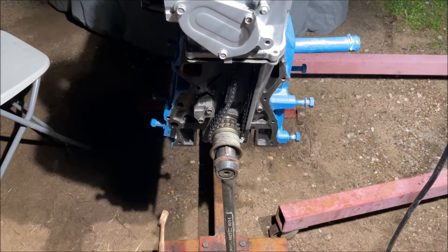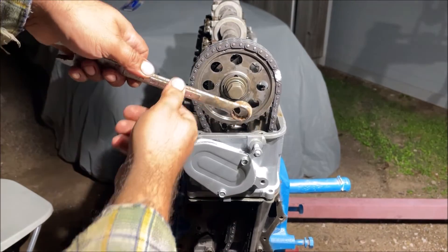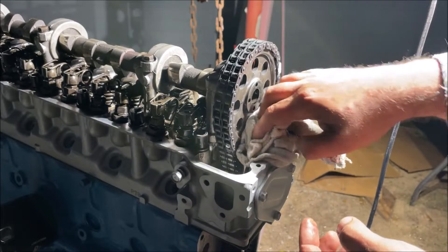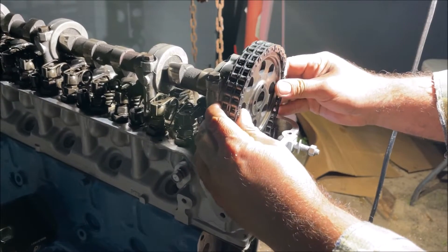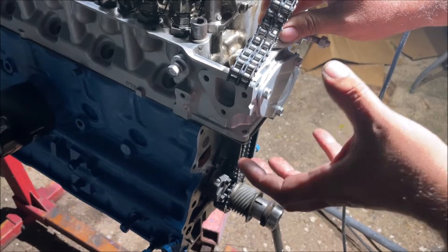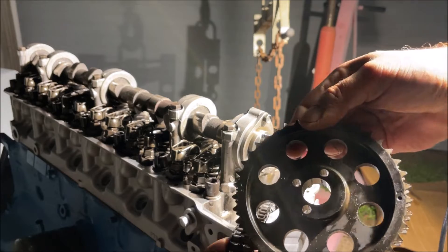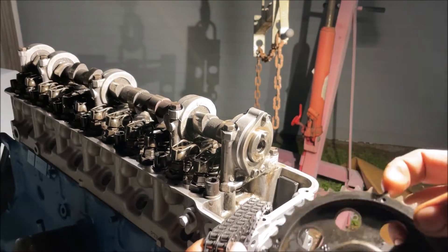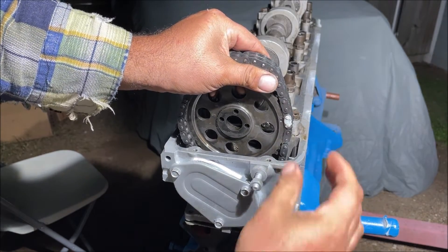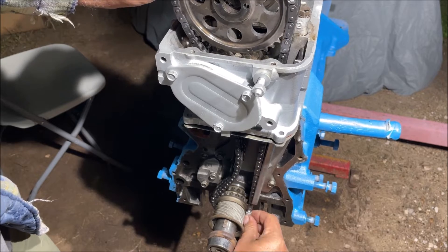Let's go over the procedure. The crank pulley does not move - don't mess with that. The key is perfectly straight up on zero. You're going to loosen your cam gear. This procedure is designed to be done in the car - make sure your chain is not going to fall in. We're going to put in this industrial chain catcher. Get your cam gear out. If you're doing this job on the car you need that tool to hold the chain, because when it just fell it did get off the mark on the crank. We took it off with one - rotate it 90 degrees where two is at the top, and now get that white painted link right onto two. I'm trying to hold this up and we actually slipped a link off our mark at the bottom - this can easily go wrong if you don't have a secure way to hold the chain.